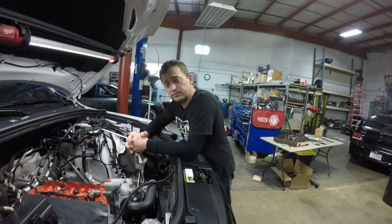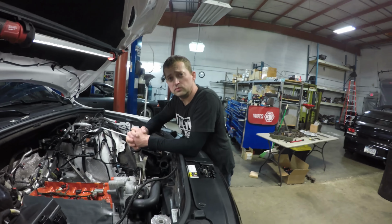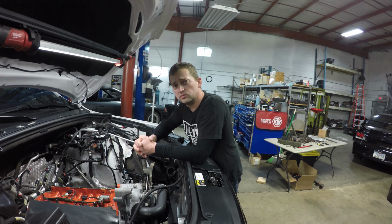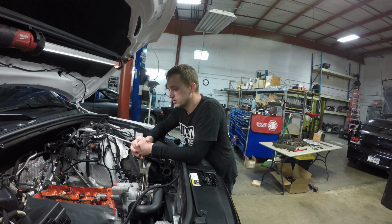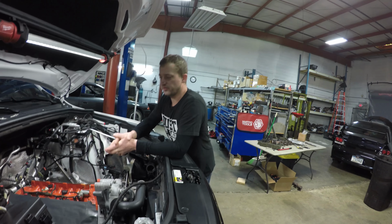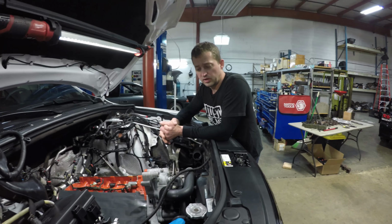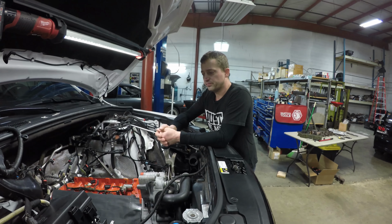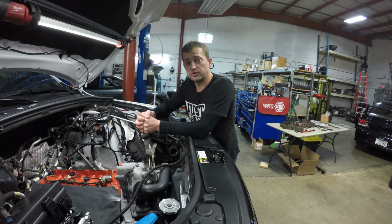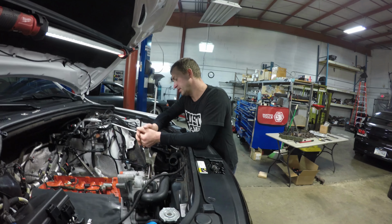Yeah, and once again, I'm just asking questions that get asked to me, but what horsepower level and boost level would justify buying the crazy Titech or T-Tech heads, whatever they call them? Oh boy. Those are racing heads, correct? Those are racing heads. I don't know the longevity of those things. I think it's pretty good, but I don't want to give information that I really don't know too much about. But would it be like 1,500 horsepower, 1,000 horsepower? When would you see real gains, in terms of boost levels? At 600 horsepower, you'll see gains. Yeah. Is it significant? It's significant. At lower boost levels or no?